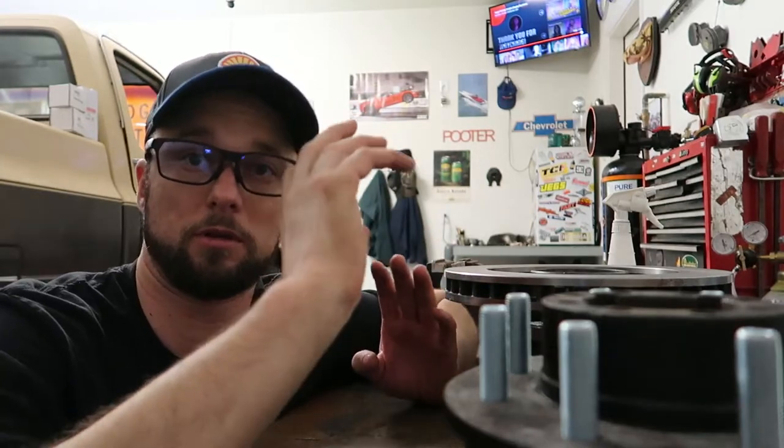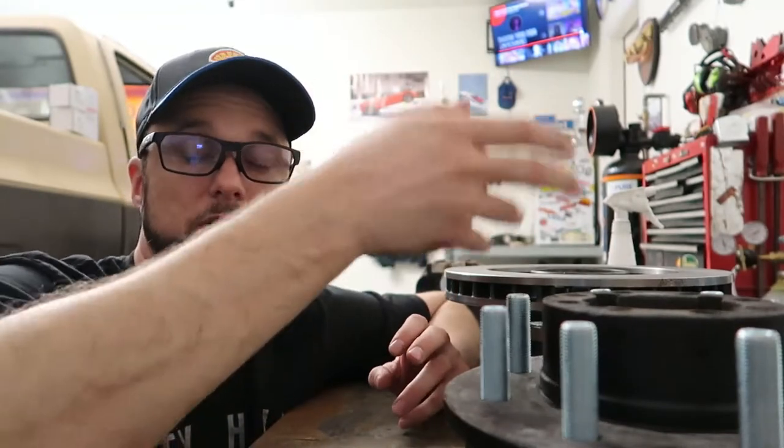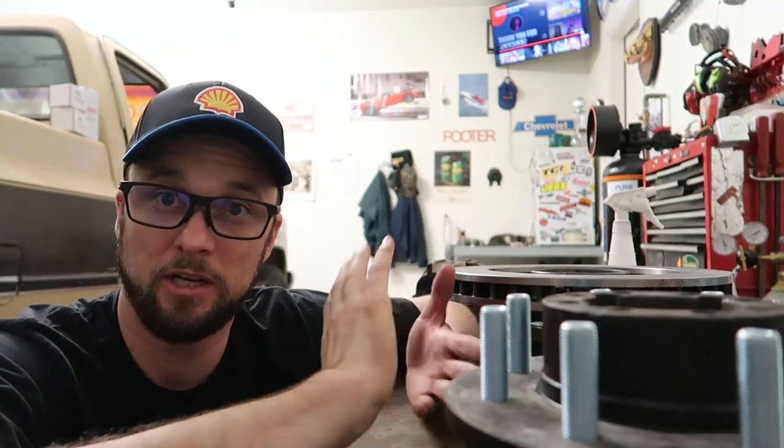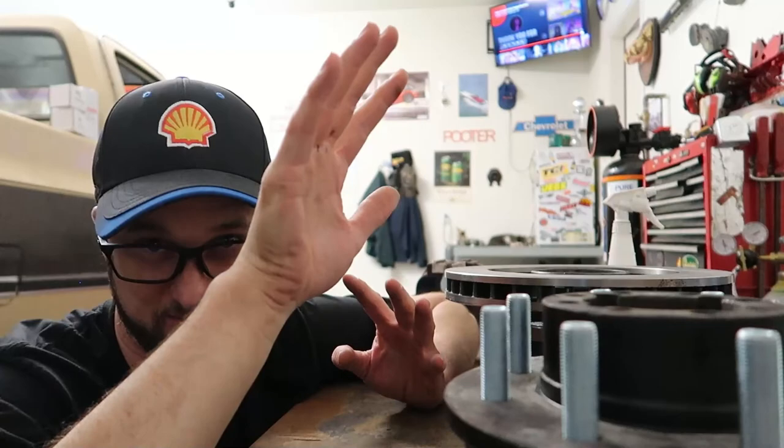On another note — I finally ordered the suspension and steering for this truck. I'm going to get parts in over the next few weeks or months. The thing that takes the longest is the springs — I'm still keeping it leaf-sprung, but they're custom-rate springs that take into account what motor you have and any other mods you're doing. It's going to have a custom spring rate; they're going to be relatively soft for four-wheeling so it should ride great. We went all out — ordered everything, all the supporting mods. We got high-steer crossover steering coming with a new steering box — all the good stuff. This is all from ORD Off-Road Designs, probably the best company to order a suspension kit from for these full-size trucks right now. My bank account is not excited, so please like, comment, and subscribe — I need all the help I can get.